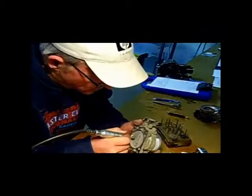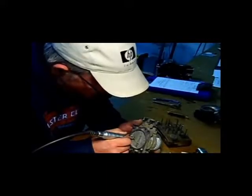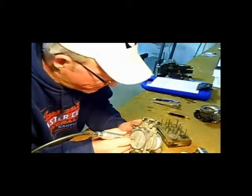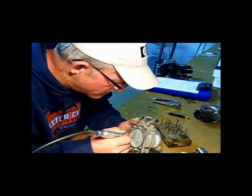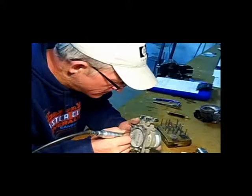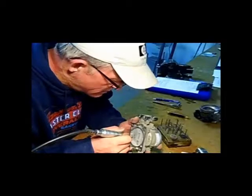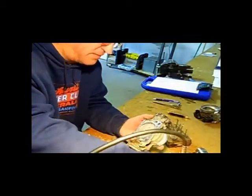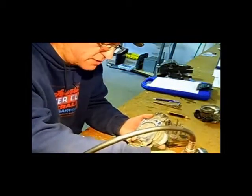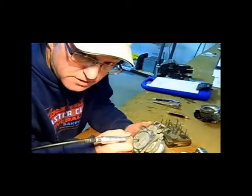Again, every time you'll want to fire it up and make sure your angle is right. There we go. And just drop it down at that angle into the metal. Very gently, so your bit doesn't overheat. Because once it gets to about 740 degrees, that aluminum is going to start sticking. You do not want that to happen. It doesn't take long to cut the groove, so don't hurry.